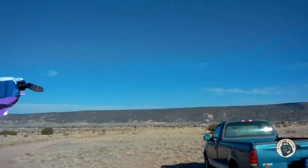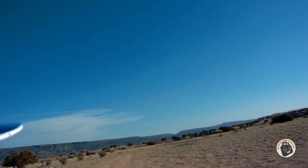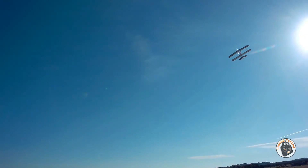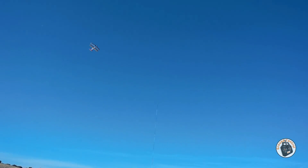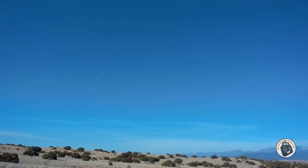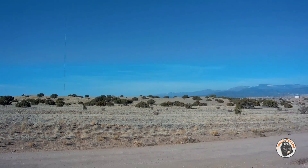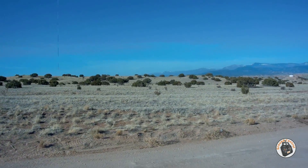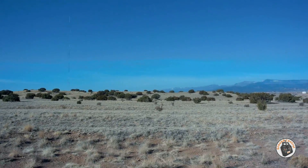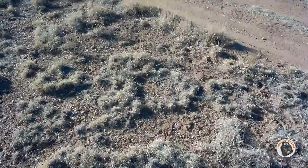Since it was so darn tail heavy, I'm starting off with a nickel attached to the front of the plane. Launching now. Certainly better, but I still have no aileron authority at all. I had to use rudder to try and get it to turn right — it just wanted to circle and went into a spiral. Let's see if there's any damage. My nickel came off!